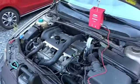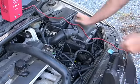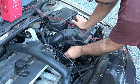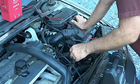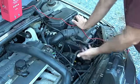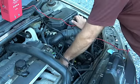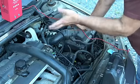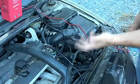And now I'll show you how to use it to find a vacuum leak. Okay, this car doesn't have a vacuum leak, but what I've done is unplugged a hose. I'm not sure, this is a turbo control boost valve. And I've unhooked another line here. This is actually the EVAP line, so I don't think these two are going to be connected, but you'll get the general idea. If I'm looking for a leak, if I can open up a vacuum line somewhere in the system, and then I can blow smoke through it, that should backfeed and eventually show where the leak is coming from.